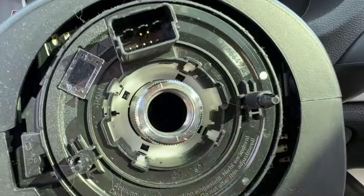Now we want to put the airbag back on. This is the first clip that goes in — pull this back out here and we're going to clip this back in. It only goes one way where that little notch is. That's clipped in. We can then put that clip back, push it in, push the wire down, and then clip this in — slide it over first. Once it's in, remember to always push this white clip in after. Otherwise you're going to get an airbag light. This goes in one way and you're going to hear a clip. Now we're in.